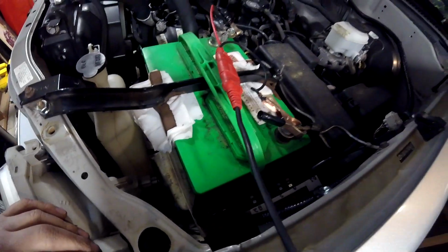Okay? So I tested the charging system on the 40 amp fuses. I'm going to do that for probably through the winter till we get to the spring season. I'll run some light loads off the camper in the back, just playing with it in the winter time. Maybe when I go down to my family's place for Christmas, I'll run a TV or something in the back and be on the road for a few days with the truck. But I'm going to do all that on these 40 amp fuses. I'm not going to put these big 80s in until springtime when I really start pulling those house batteries down.